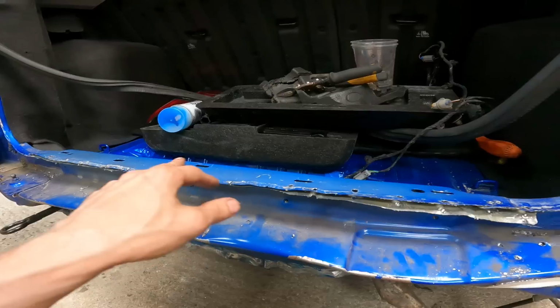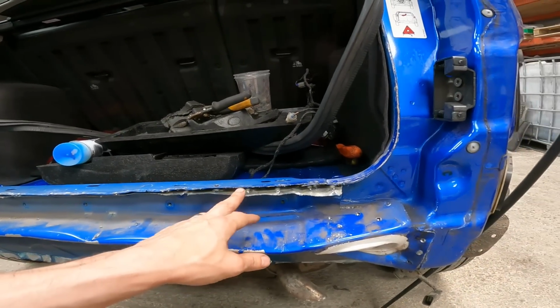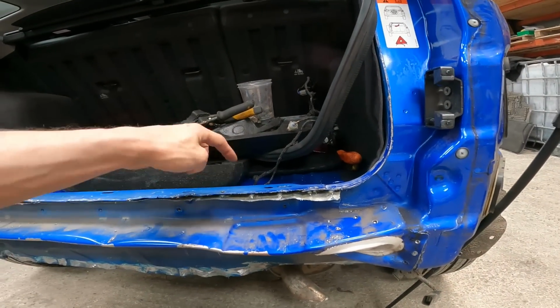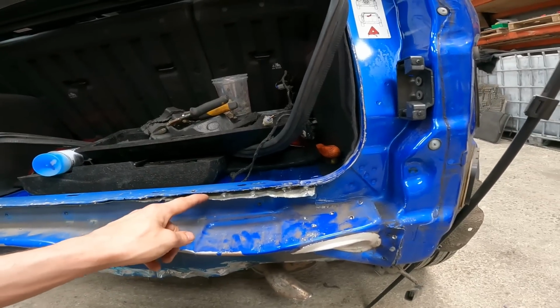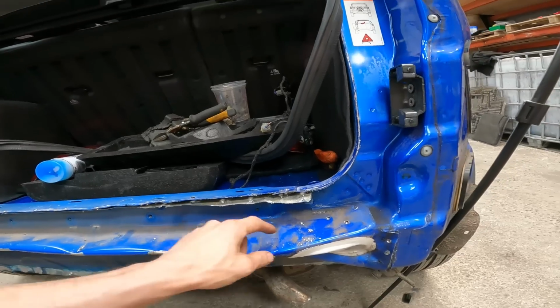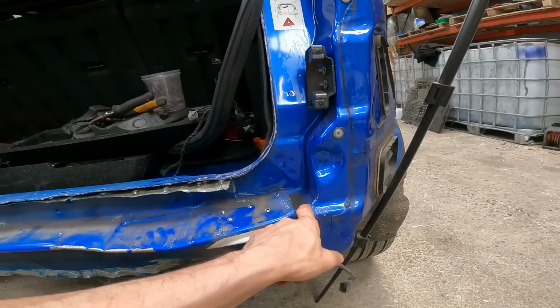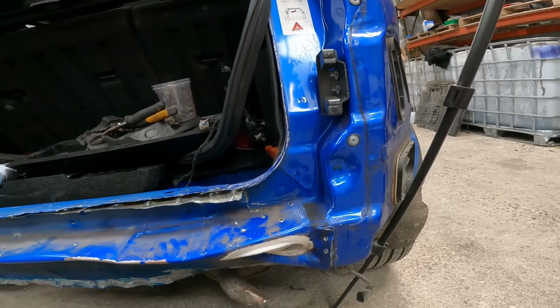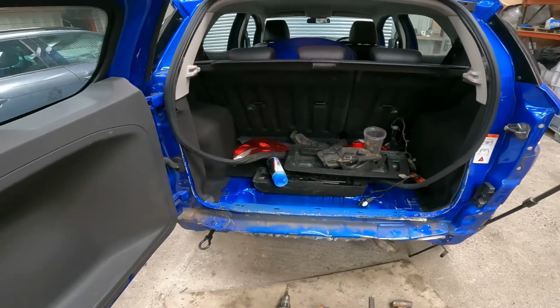But along the top, actually, it doesn't matter, because you're going to be spot welding from the top. The hole wants to be in the top one, and the new bottom one doesn't have any holes in it, so that along the top wouldn't matter, funnily enough. But yeah, down along here, we don't want holes in the steel in the back. Anyway, it's going well, so I'll carry on now.